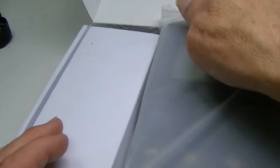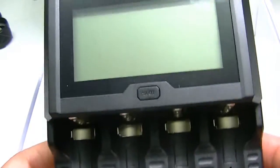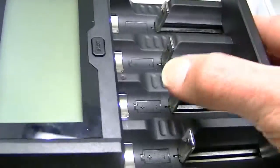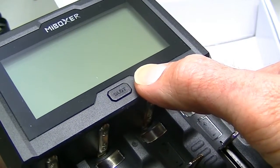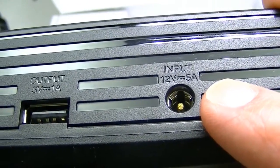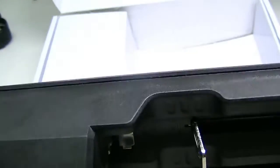Here's the charger. Among four-bay chargers I've seen, it's a pretty standard size — not terribly small because it will take all batteries of reasonable size. The slots are pretty deep, so they do accommodate those sizes. The springs are very good within the slots. There's a slot button here which is the only button on the unit, and it changes the display. On the top are your connectors — here's your wall adapter connector and here is your USB output for when you want to use the power bank, with a 1-amp output.